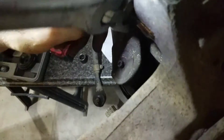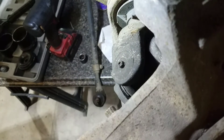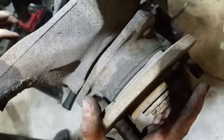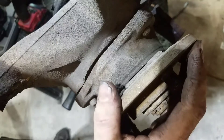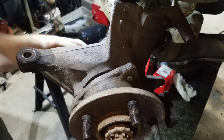There's three of these, and this is why I took the knuckle off so that everything can be moved out of the way and you have all this extra room. To break these free I'm using a 24-inch Craftsman half-inch ratchet. Like I said, these were just out about two years ago so they weren't too terribly bad. When this gets put back together this time, I'll clean it all up. I didn't have any anti-seize at the time — I was in a hurry, my daughter was moving to Texas. We slapped it together with new wheel bearings and got the new U-joints put in. This time, now that I have a little extra time, I'm going to anti-seize that all up when I put it back together.